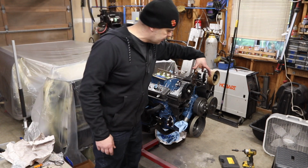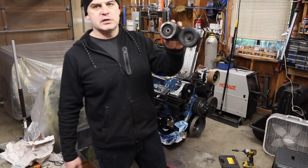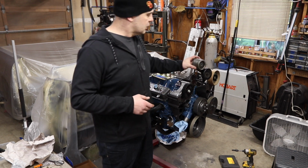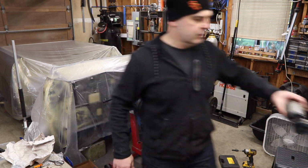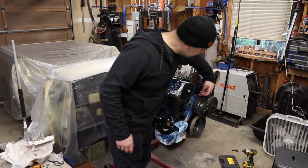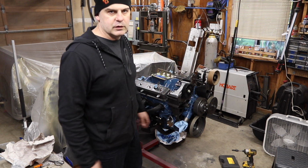The only things I'm missing right now are the tensioner. Can you believe it? I got two, that's this tensioner, right? This is the old piece of junk one, which I would reuse, but the bearing on this is shot. So that goes here and puts tension on the belt. I got two from the auto parts store, and both of them were bad. It's unbelievable. And then I can't find the idler pulley that matches the one I have. The one they have is more of a donut, and it doesn't work with the washers and stuff.